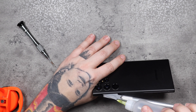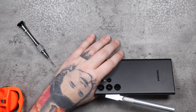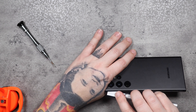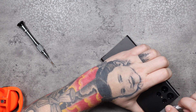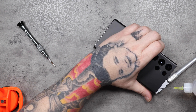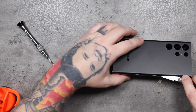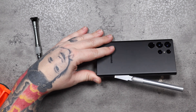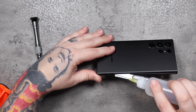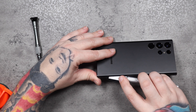You just have to be careful. If you get any kind of resistance, use more alcohol. If you're doing it right, your blade should slide right through. When you start to slow down again, use more alcohol. You want to be really careful — if you break the glass on a brand new phone, there are no replacements. Since it's just a back glass, there are no back glass replacements for these phones yet, so you'll have no back glass on your phone.